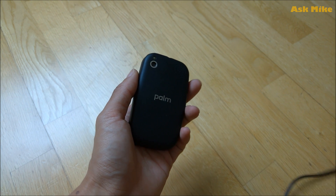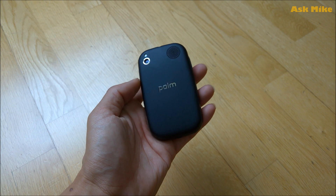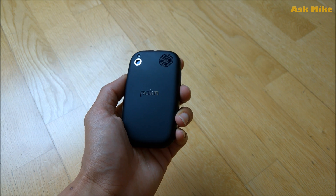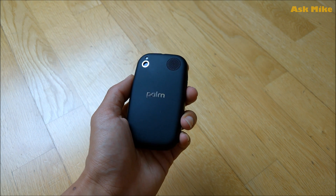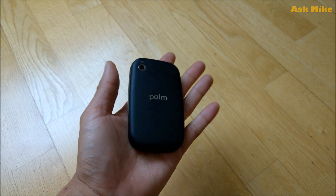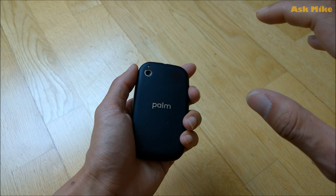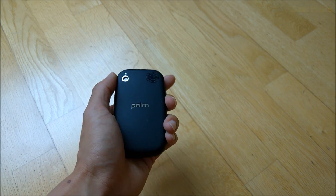Okay guys, that is the step needed to flash the modem. For those who encounter webOS Doctor issues when restoring back to stock for their Palm Pre phones, you can use these steps — but it's mostly applicable for those stuck at 58 to 62 percent, because their problem is actually flashing the modem itself. If you have tried whatever ways you can to restore your device but can't get things done, the last resort is to do a modem firmware update as I've done, and now the phone is back to working condition. That's all for today. If you like the video, please give it a thumbs up, and if it helps you and you like what I'm doing, please subscribe to my channel. Hopefully I'll see you again soon. Bye!